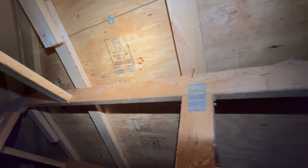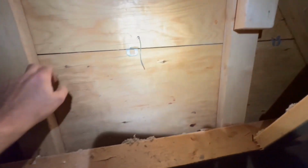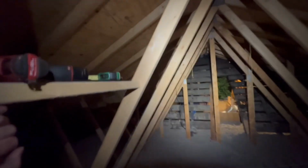It's a little bit thicker than half an inch. Didn't expect that, but we've got plenty. There's 20 inches between these two, so we can make a nice round hole. Then we can put the ducts right here, and away we go. I do see some rust spots, so these nails are rusting, so this will help ventilate things. We do have a ridge vent, but it's pretty freaking hot up here. I like this shelf. Shelf is handy. So we're going to have to run the ducts, probably cross over to here, then up here, then across or something. We'll figure that out later.